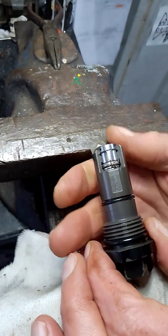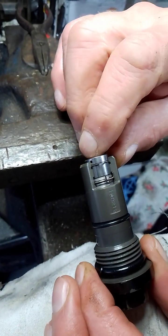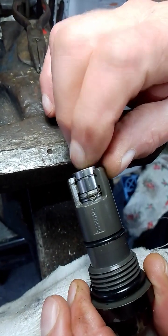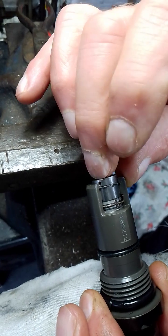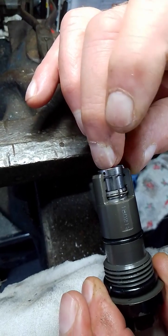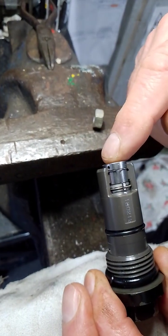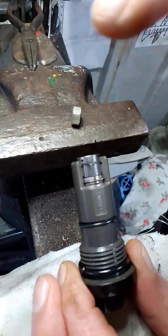There you see it's set. That small spring - I hope that's focusing - that small spring is in the upper part of the groove. The upper part of the groove is smaller, so it traps that spring. So that's reset now, and when you put it in the engine you turn the engine backwards and the chain goes tight on this side.